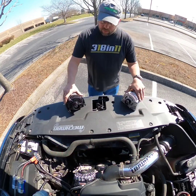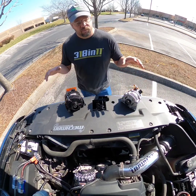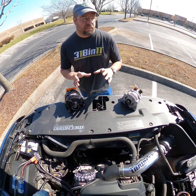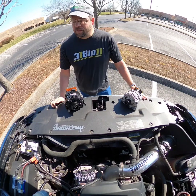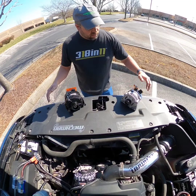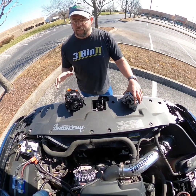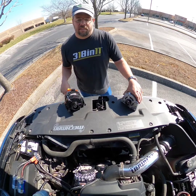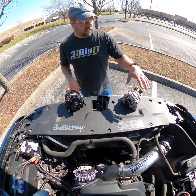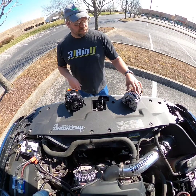Just a few things to consider. These are the same fitment alternators but for different applications and uses — you've got to pick the right piece for your application. You don't take snow tires to a drag strip. Small case is good for racing applications or high-RPM usage. Large case is good for low-end grunt like big block applications and piles it on at the top. If you can fit a large case, great — you get the best of both worlds.